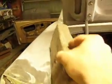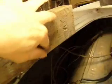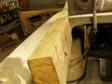And one of the things I had to do was put a 2x4 right into this gap. I can't find the actual 2x4 I used, but I had one where I cut a notch into it so this would slip right into here. And then I clamped it down through right here and behind. And then I grabbed a Porta Power, and it was based right here, and then went all the way to the 2x4 and pushed it up and out.